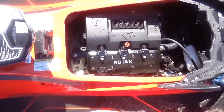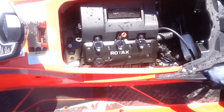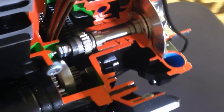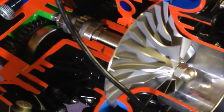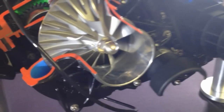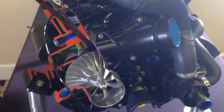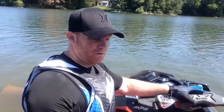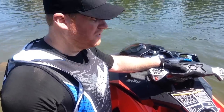There's a brand new supercharger with a new wheel featuring extra blades, pushing 18 pounds of boost through a smaller diameter wheel. The supercharger itself is maintenance-free — you're no longer having to do a rebuild service every 100, 150, or 200 hours to replace clutch washers. What they have now is a new clutch pack of eight clutch washers and composite bearings with a very large input shaft almost an inch in diameter. The best minds in the industry agree Sea-Doo really stepped up with the new 300 motor — it's meant for just hauling on the lake, and you're going to give up before it does.